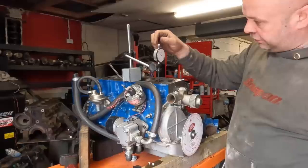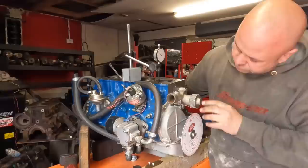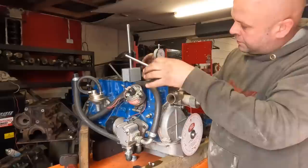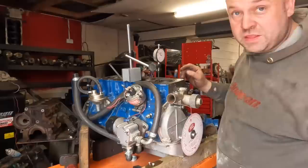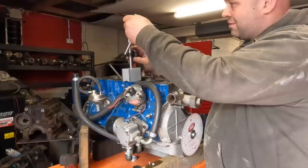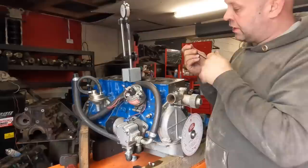I'm going to check all my measurements again because I don't want this to be wrong. I'll do TDC first, then check the rock on the piston. It's actually nine thousandths of an inch and the needle doesn't move when I give it a tap. We know the piston is nine thou down the bore, so we can run that flat top. Straight away we can make an improvement on the engine because I can drop the deck of the block down by another nine thou.